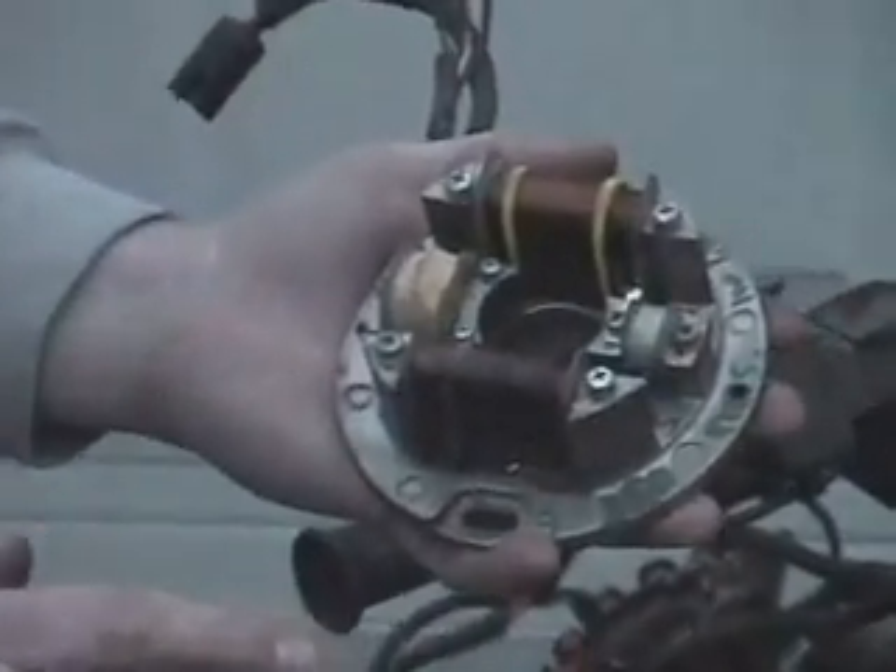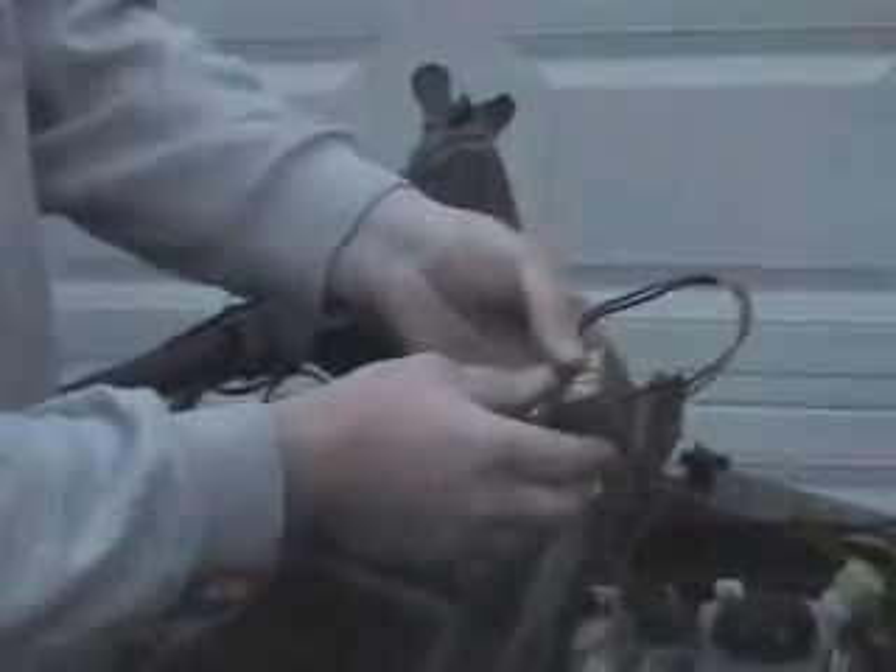Our general path of power, at least on sleds and most two-strokes in general: we've got our stator in there, the flywheel goes around the stator, excites the coils, puts out the AC voltage, comes out of the plug, and goes into the wiring harness. When it goes into the wiring harness, the first place it goes is to the regulator. I hear guys say regulator, rectifier, rectifier-regulator. Regulators regulate AC voltage — this is just an example of a rectifier. There are lots of different types and styles of regulators.